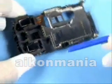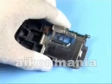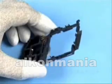Gently lever out the glued antenna speakers. The gaskets will be destroyed. Remove all residues before reassembly. Lever up the first metal latch of the BB shield and then the second one. Do not touch or bend the gasket. Keep it together with the PWB.